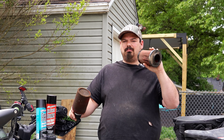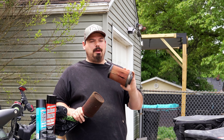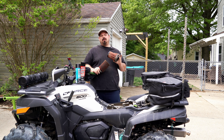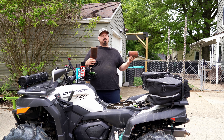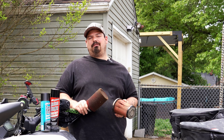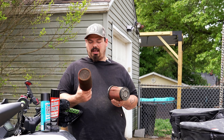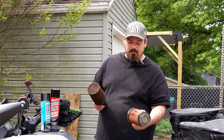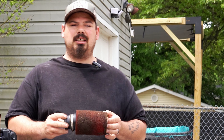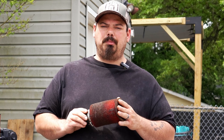You don't have to be going deep or drowning your machine in a lake to destroy an air filter. You could simply be riding in heavy rain or really wet environments and the moisture alone is going to soak it up. I know people say 'we don't have that problem in our cars' — and technically in the right situation it can happen, but cars are so enclosed you're fine. But I have seen it on off-road vehicles happen multiple times depending on the airbox design. It can happen — might not happen to you, but it can.